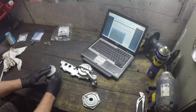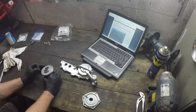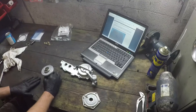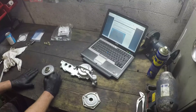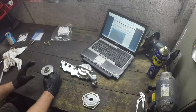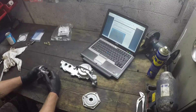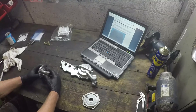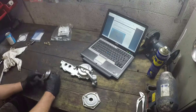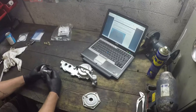Basically the process for adjusting it is taking it out, taking the ring itself and the centre washer that the two bearings run on, and sanding them on a very flat piece of glass with 400-grade wet and dry sandpaper, then putting it back together and replaying with it until it can move. It needs to move but it doesn't — if it's bound then you're in trouble. If it is bound, take it apart and sand down the two internal parts. This one I've been lucky enough to find is absolutely rock solid.